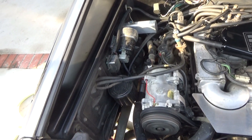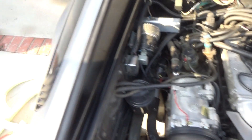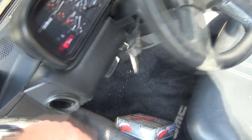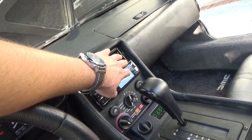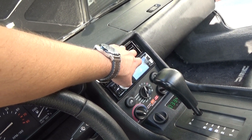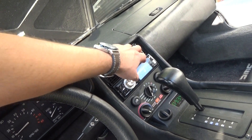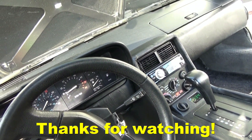We started up the car and ran the AC — the compressor is not cycling, we've got good pressure in the system, and the car is blowing really cold with the Red Tech. It's a pretty warm day and it's feeling pretty good. We only used two cans — they recommend a little over two, like two and a quarter or two and a half — but we'll see how it works out and top it off later if needed. Anyway, that's the video, thanks for watching!